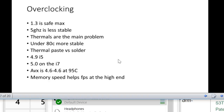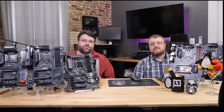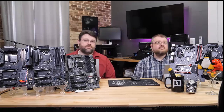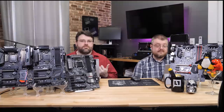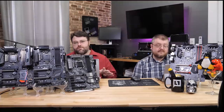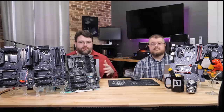All right. So overclocking. 1.3 volts-ish is kind of safe. This is all anecdotal, by the way. This is not our full testing. We have not done super full testing. We've only had really a few days with the CPUs. For cooling, we're using 240 and 280 millimeter closed loop radiators. So take all of this with a grain of salt, and the load line calibration and the voltages and things like that.